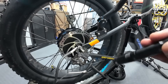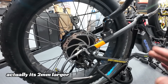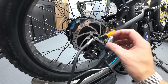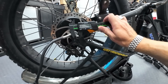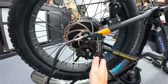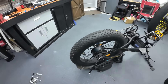The axle is taller — about one millimeter taller. That's all it takes with these small clearances: that one millimeter is keeping this from sliding all the way down and allowing me to use the torque washer. Using my digital caliper, the flat-spot-to-flat-spot width is the same at about 10.2 millimeters for both. But the threaded part diameter is different — the wired motor's axle is about 13.7 millimeters, while the smaller axle is 11.6 millimeters. So it's not gonna work.